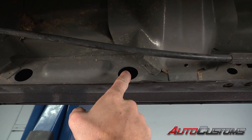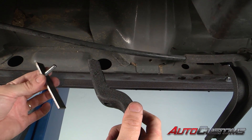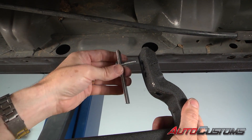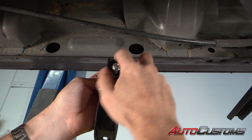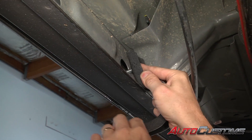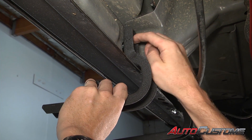Next we're going to come back to the first round hole — that may already be covered by tape. We're going to take our bracket and the provided bolt plate, go through the top oval-shaped hole in the bracket and come around the back side and put on the serrated flange nut. We're going to run that right through the hole, and again we're going to tighten this down just finger tight for the time being.